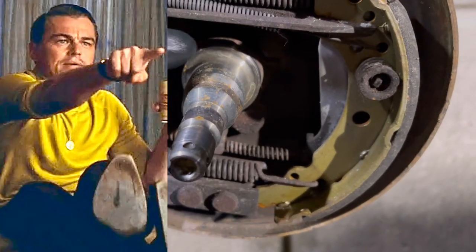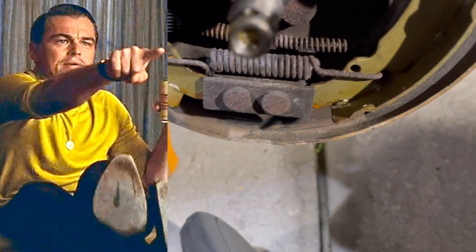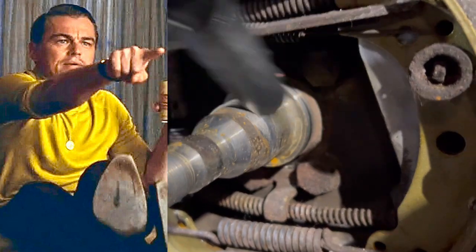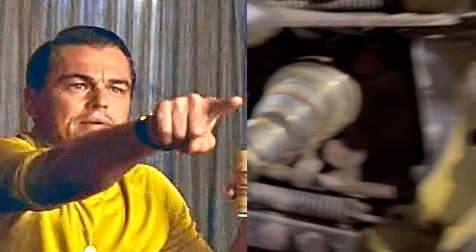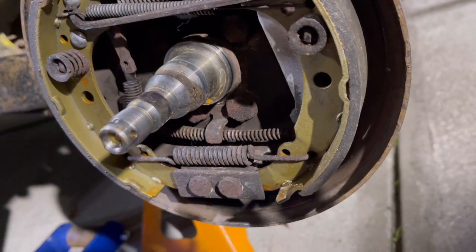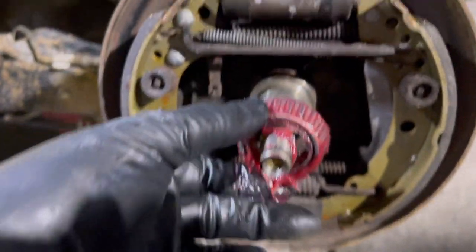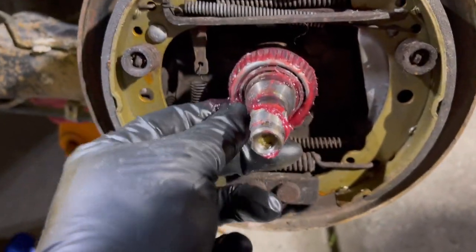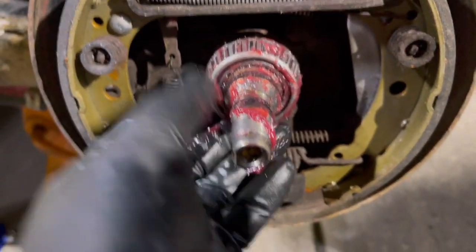One of the things you need to do is make sure that the stub axle is in good shape. As you can see here, it looks like it's got some rust and some wear marks. You want to take some fine sandpaper and just get this cleaned up. Then you want to make sure that the new bearing actually fits over the stub axle properly. I should have done this before I greased it — you see that? It is sticking, which means there's some damage on there that needs to be fixed.